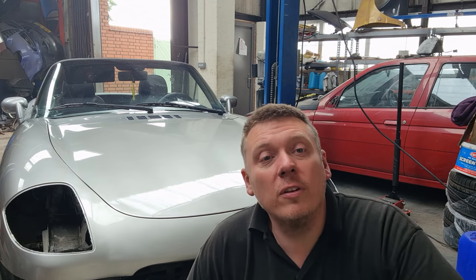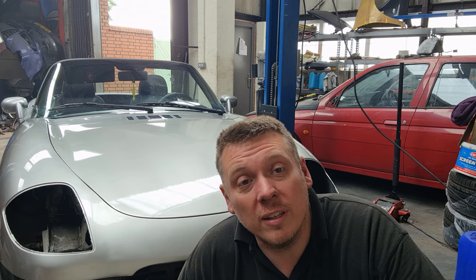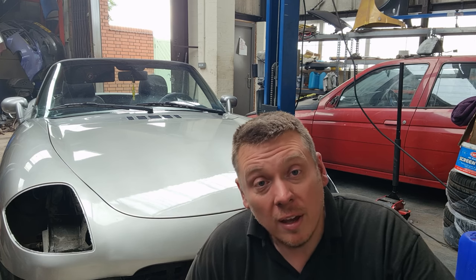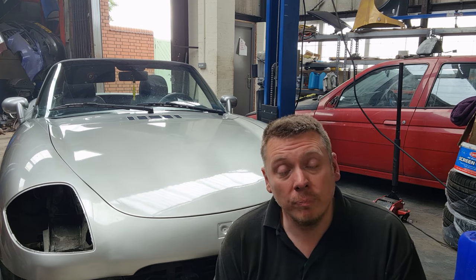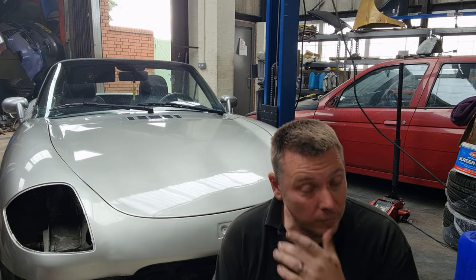So there we go, end of another busy day working on the car. Quite a bit achieved over this past 2 weeks, don't you think, with the front end being repainted and literally all the mechanics done to it. That with a little spot of welding's been done as well. I will just want to give it a coat of stone chip once it's fully dried overnight. I have applied some seam sealer to it, so that will hopefully never rust there again.